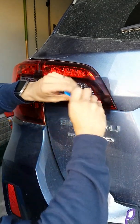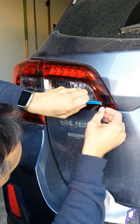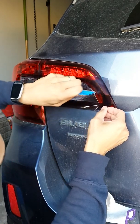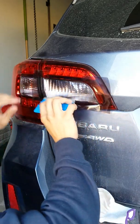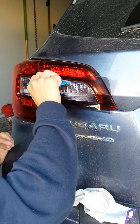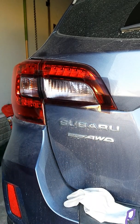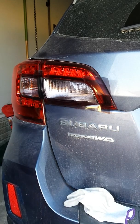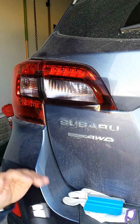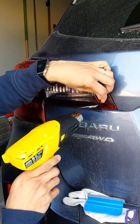I've got a little divot corner here so this is going to be a little tough. I'm going to lift it up a little bit and feed that in as well. I think this is where some of the cold is affecting things - despite how sticky this particular film is, because of the cold the adhesive isn't working quite as well. So I'm going to touch it with a little bit of heat to make it softer and make that adhesive a little bit stickier.